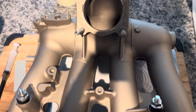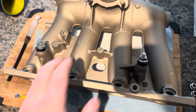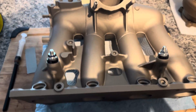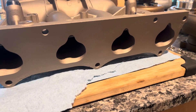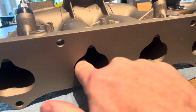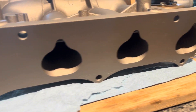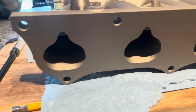Went ahead and ceramic coated it, just to keep the radiant heat out of the manifolds, putting some stainless hardware on it, getting it all ready to go. For the runners, just some very minor porting to knock away casting flash and make it totally smooth — these are still at stock diameter. The heads on this and the manifolds are actually pretty good; they're definitely not the worst of the K-Series manifolds.